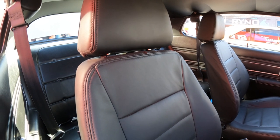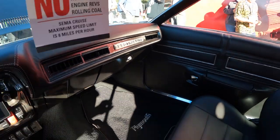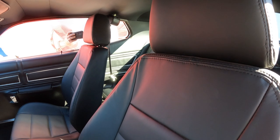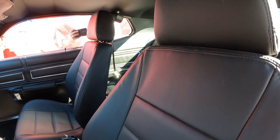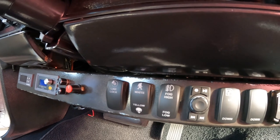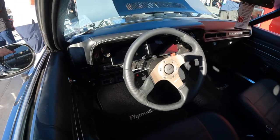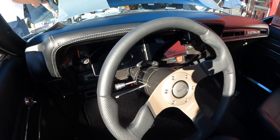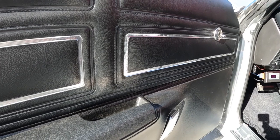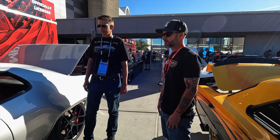The interior is all factory reproduction except for heated leather seats, kept intentionally old-car in feel. It also has full air conditioning, all thermostat and PWM controlled, so the 400-volt AC compressor speed can be varied - running at low RPM and lower amp draw on mild 80-90 degree days, or cranked up to 6,000 RPM to cool all day long when it's 100 to 110 degrees outside.